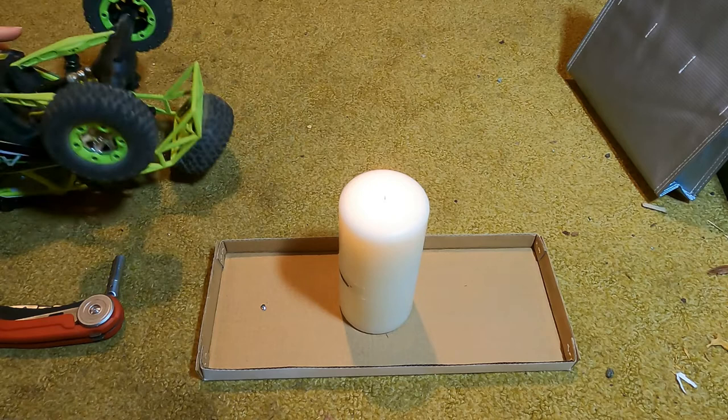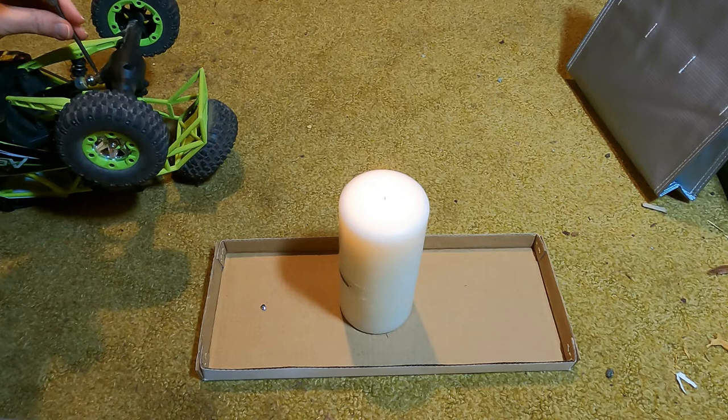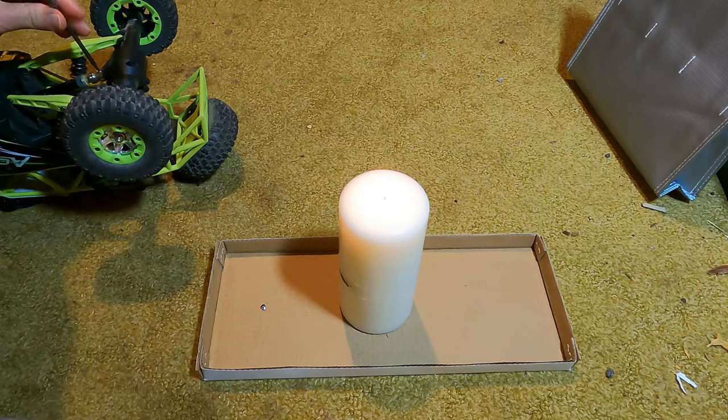Now that it's heated up enough, remove the grub screws on the top and bottom sides of the drive shaft if you can. But for mine, I had to drill out some of the grub screws as the thread had stripped already. This took quite a while as I didn't want to damage the inner metal piece for when I'm reinstalling the new drive shaft.